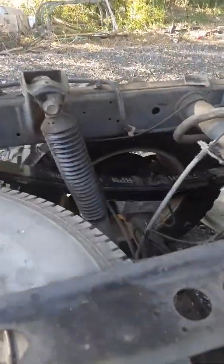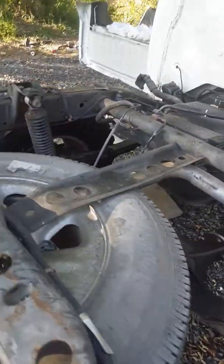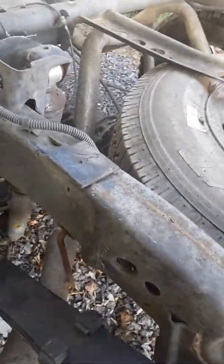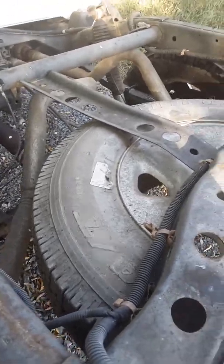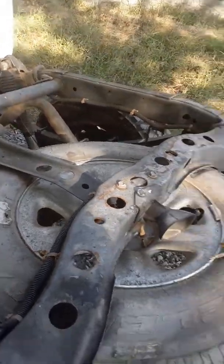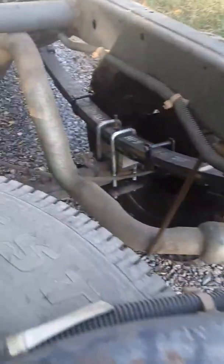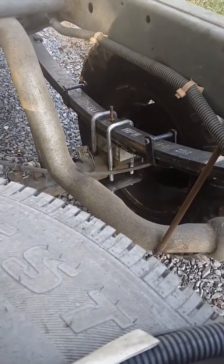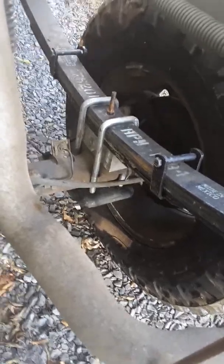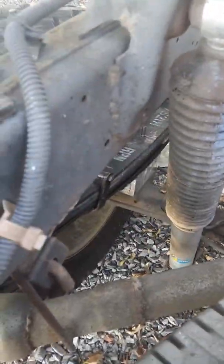This is the side I did, and then the other side I had to finish up — I just got to put on the u-bolts and bolt it down. The leaf springs are supposed to give about two and a half inches of lift. I couldn't use the four inch blocks because the shocks weren't long enough and were fully extended, but I had the two-inch block as you can see there.